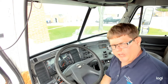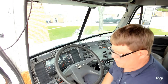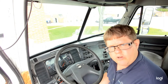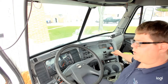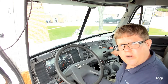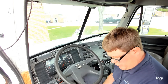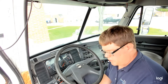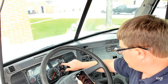To do this test, it said with the engine stopped — not running — so that's taken care of, and brakes not applied. That means not pressing on the service brakes, but it also means the parking brakes must be released. So make sure that the wheels are chocked, which we did prior to starting this video, and we're going to release our parking brakes. Give the parking brakes a moment to stabilize pressure, and then you're going to watch that gauge for the specified one minute. It's a good idea to maybe snap a picture of it with a phone, so you have something to compare with. I will start our timer now, taking note of where both needles are.